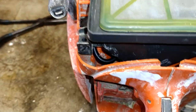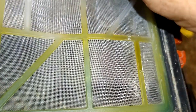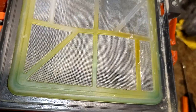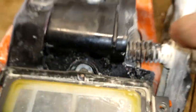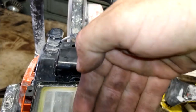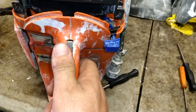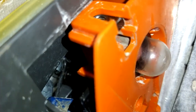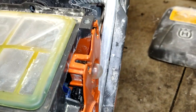With everything lined up, make sure it's down in that, that's all lined up. Make sure no fuel lines are pinched, make sure everything goes in there just perfect. Now we're going to take our screw to the top here, shove that back into place, and tighten it down through this little hole right here. That tightens right in, and then the bottom of that plate just sits down into a lip — if it's on the outside of the lip you'll never get it lined up, so get it down in the lip, then into place, then tighten it down. Then go ahead and pull on your trigger and make sure everything's working good. Make sure your choke is working properly — that's all working good. Before we put all this together, we're going to put some gas in it and prime it and make sure it's priming up.